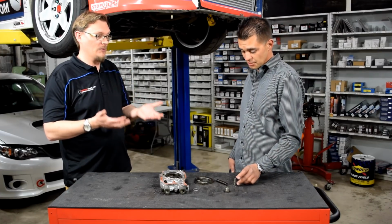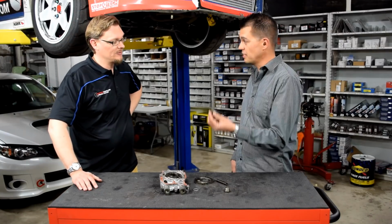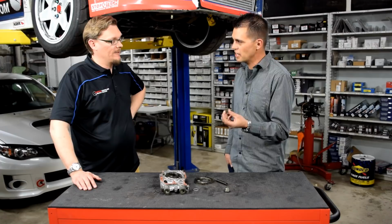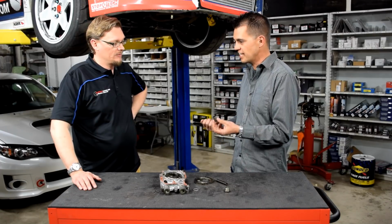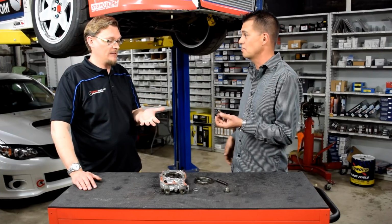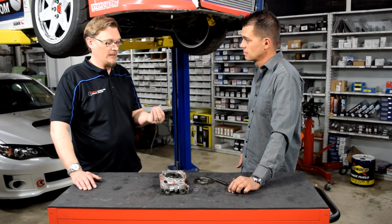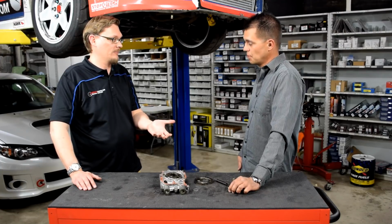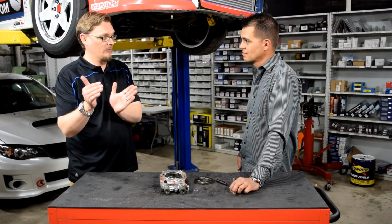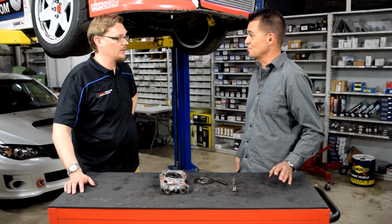Right. So now the next step was? Well, the next step, as some people would read, is add more shims. And I didn't want to try that because I think that was the equivalent of taking a garden hose and just squeezing the pressure tighter. Right. Well, and still the same volume behind it. In the condition where you were most concerned, you had not seen any improvement with adding a shim. No. So that would also make sense. Well, don't add more shims because you weren't fixing the real problem area. Try volume. Right. Let's see what the other pumps do out of curiosity.